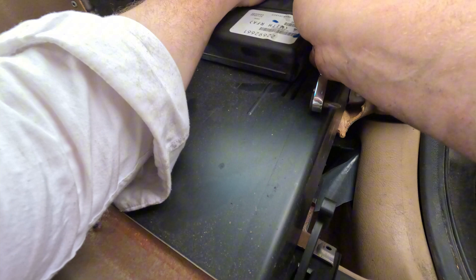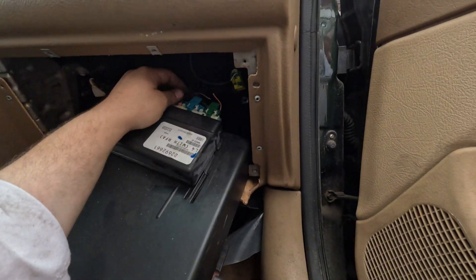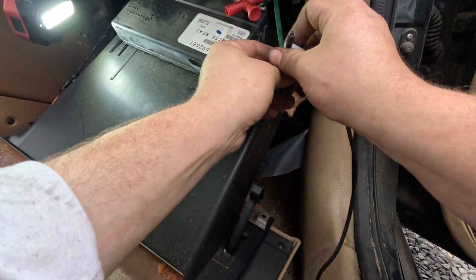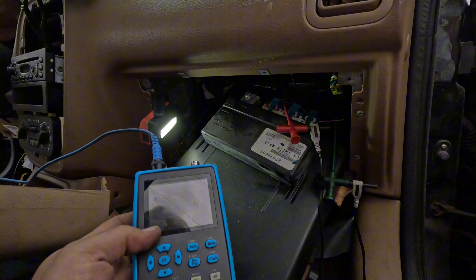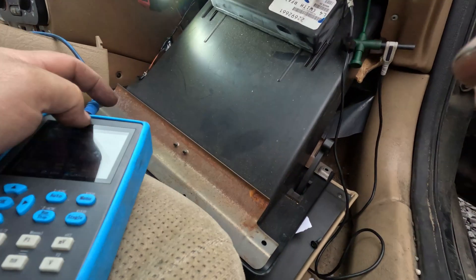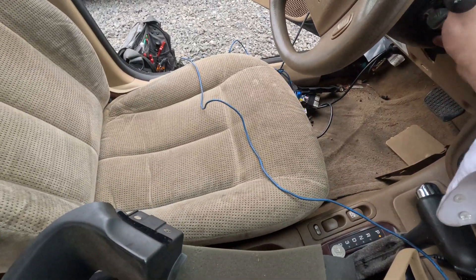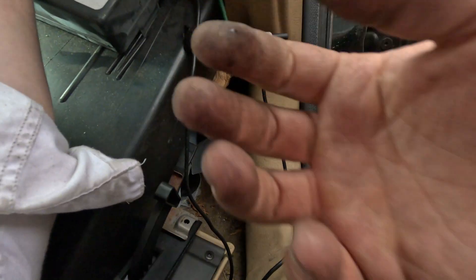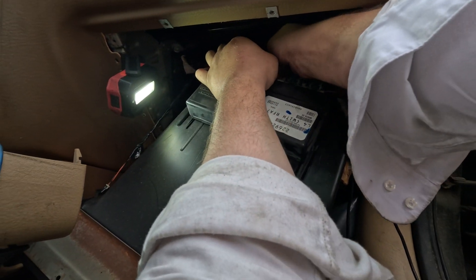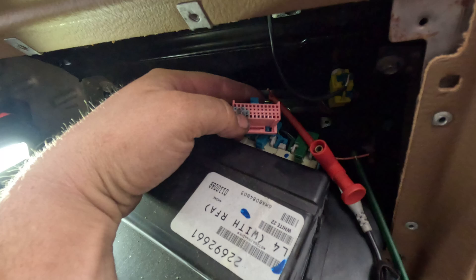Is that the whole thing? It's a purple wire. Let me jump this together temporarily just to see if it does anything. Still got nothing. Let's try to start it — still starts and dies. Looking at the diagram for this connector, I see a bunch of purple wires. I unplug this one — corrosion right there. This is bringing down our Class 2 network. See that corrosion? Unplugged it and my scope reading is at zero.